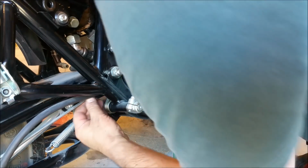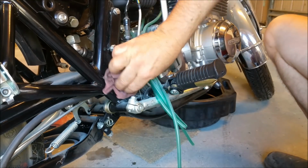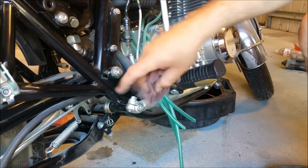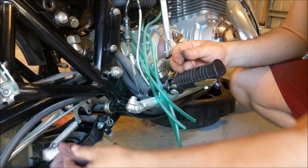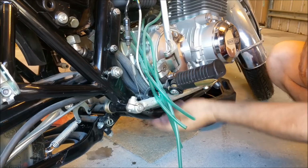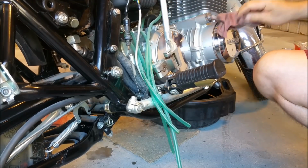I want to see if I can jack that brake pivot and stick it on the 350, because the 350's one is too short. Although this, if you cut one of these up, this is a K8. K7s and K8s have a longer swing arm. By the time they came out, Kawasaki, Suzuki and Yamaha had faster bikes than the original CB750. So rather than selling it as a performance bike, they were marketed more as a tourer by then. So they lengthened the swing arm